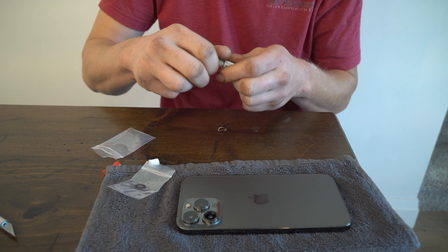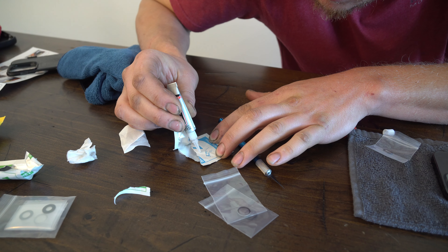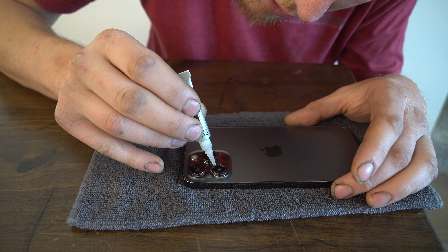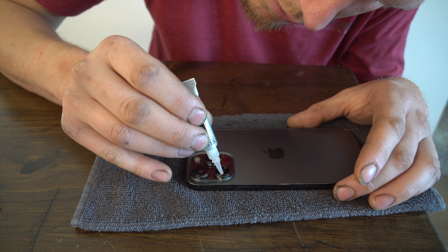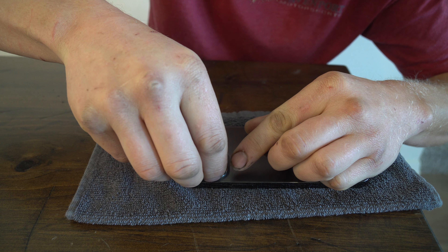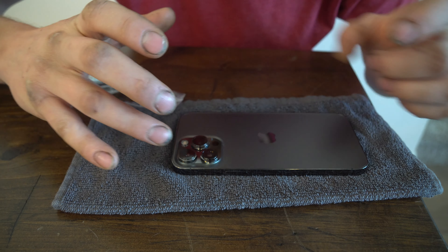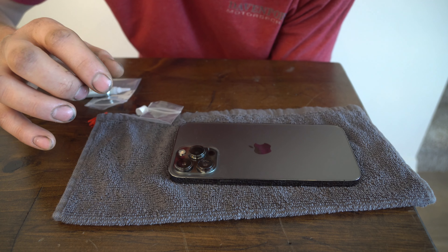To waterproof it, you need to be very careful — you don't want to damage your lens. We have to poke this; the other side of the cap is the pokey, just pop it through. What I suggest you do is do a test strip just so you can get used to how much comes out. Then go along the edge here and do a small bead — you have to know the pressure. Okay, take the lens immediately and drop it on there and sink it in.